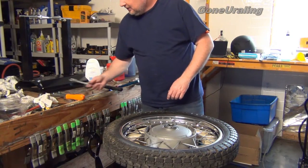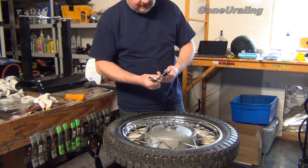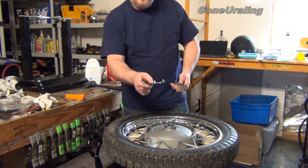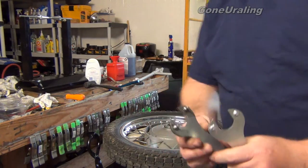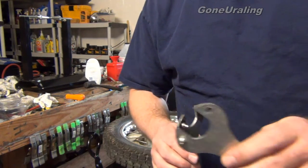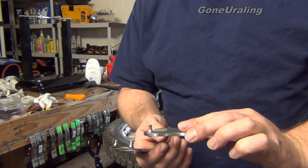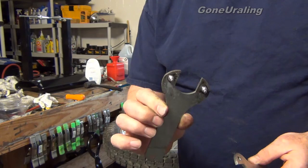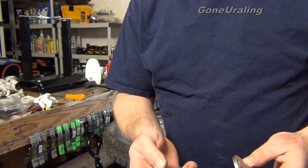The Russian tools they provide are about the same quality as the Russian bike — it's a love-hate relationship. The little retainer ring wrenches they give you: out of six tires, this is actually number seven because I had to do the spare on the Patrol. The little pins lock into the retaining nut so you can unscrew it and get the bearings out. I'm going through and checking all the bearings and re-greasing. This one popped out — they're just pressure-fitted, riveted, not welded. I put some JB Weld in it and let that cure overnight.